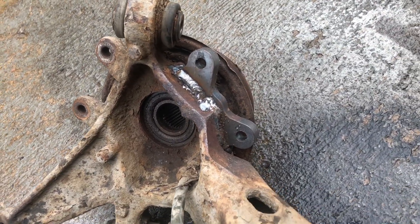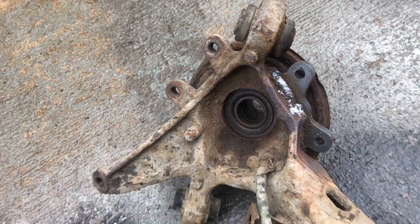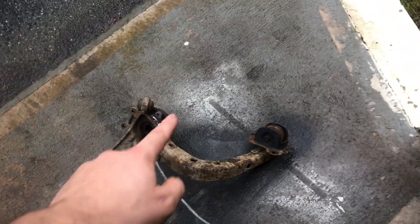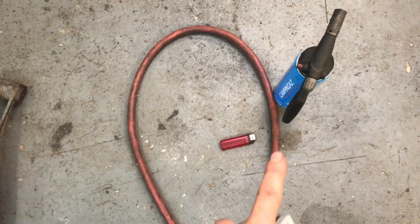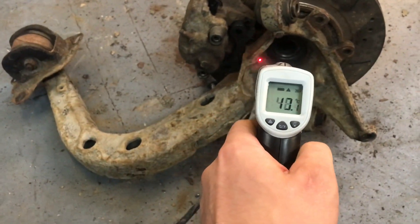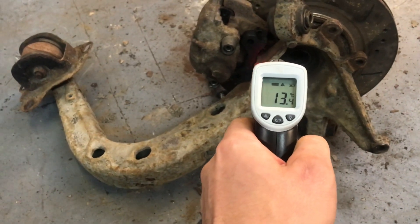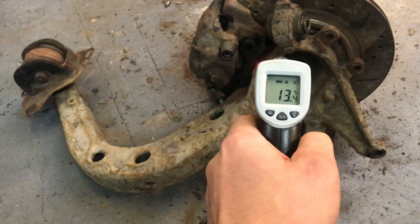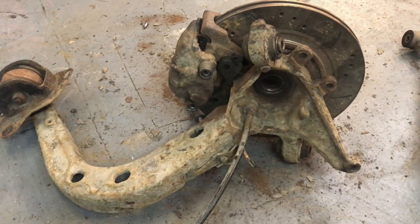This is the one I've already welded - it welded okay but I turned the settings quite high. When I was heating it up - I'll show you what I used - I was using this to heat it up. You want to get it around 50 to 80 degrees before you start on cast. The gun is only reading 13 degrees right now, so I want it around 50 to 80 before I begin. Let's smash this out.